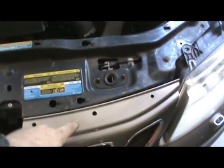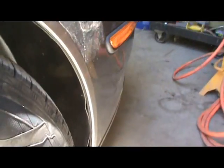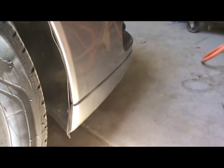I've got to take this whole bumper cover off, which is going to be tough. I've got a few of these clips out. I need to take these out inside the wheel well — there are little bolts that fasten it here and some underneath. But this car sits so low I'm not going to be able to get a good camera shot of that, and I don't have a lift, so I'll show you those when we get it off.